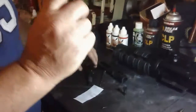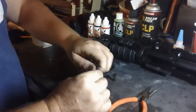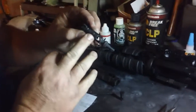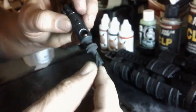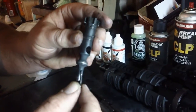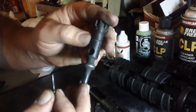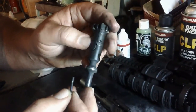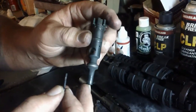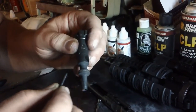What you want to do first and most important of all — I'm going to point it out with the cotter pin here. On this assembly, on this ring right here, you'll see little holes or grooves or indentations. There's one right here — it's pretty small. Here's the second one, and turning it there should be three: one, two, three. Make sure they're not all lined up in a row. Make sure they're away from each other. Very important.